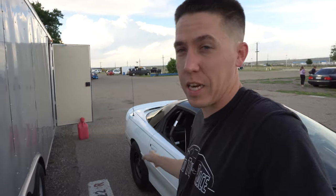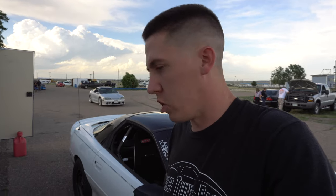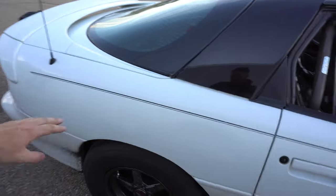Everyone, got Salty back out — I'm gonna do some testing tonight here at the track. I got a big race tomorrow for True Street where we do the drive and then race. So I got the radials back on. Last time you guys saw the car, I had some issues getting the car to 60-foot and run the time it did — it was going like 6.0. I usually go 5.80s. I actually turned it up more and it still only went 6.0, so I'm thinking I was losing the 60-foot to not having the radial on — I was running the bias ply. Now that I got the 275 pros back on the car I think we're going to be good to go, so I'm gonna head up right now, make a hit, and see how it does.